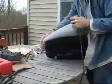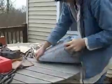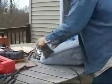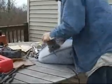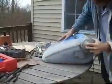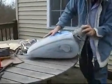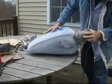At which point you can come up to an 80 grit paper right on top of the metal after you've done filling in and doing the rest of the job. Come up to 80. And then over 80 or over 100, you can spray a primer base, which is one of the final working bases before you start adding color to the tank, which will come a little later on. Just remember, have a grit that cuts quickly and gets you down to your working surface.